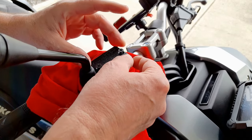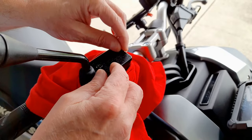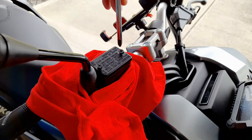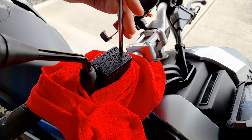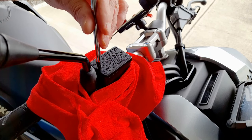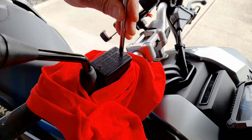I did not show myself adding brake fluid because mine was already good — it might have been a hair low, but it's still well above the low mark on the window. So you basically bleed the brakes and add more fluid until that process is finished. To prevent air gaps, don't let the fluid run completely dry. You always want to have enough brake fluid in the reservoir so it doesn't cause air bubbles.